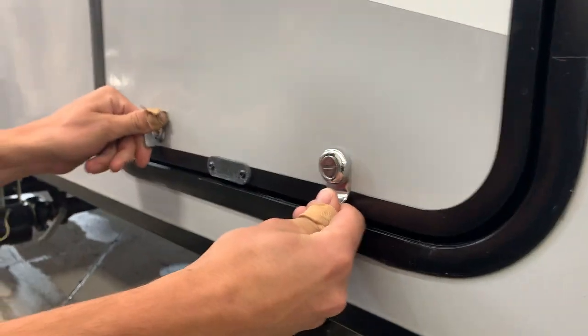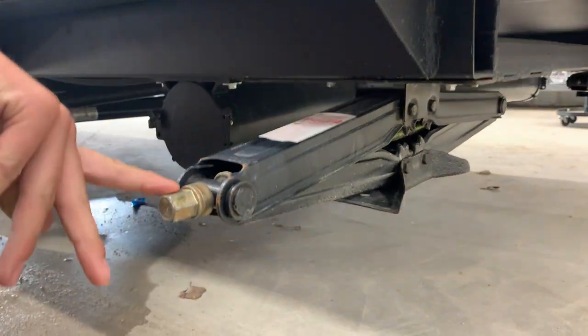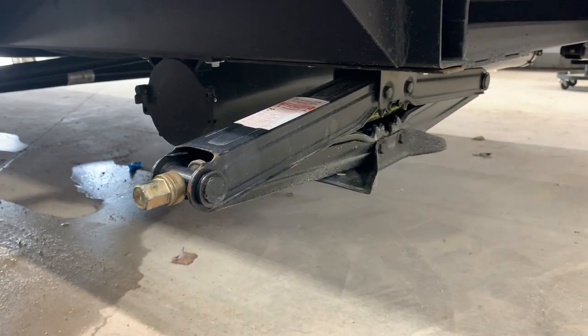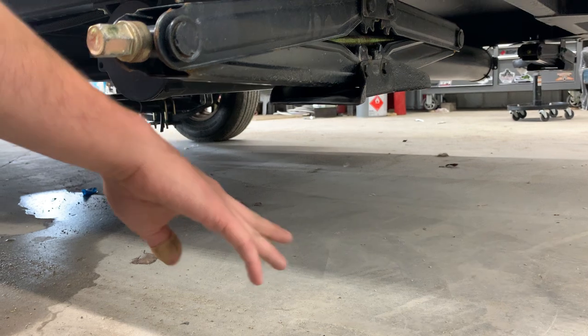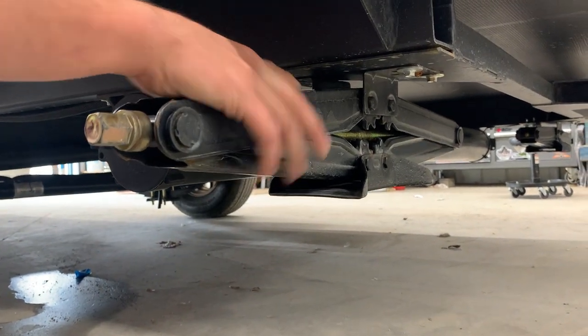You do have a little bit of storage space in this corner as well as all four corners of the unit. You do have stabilizer jacks — the way those work is you just take the tool, which is located inside the front compartment — it's just a three-quarter inch socket. You take this foot, run it down to the ground. Once the foot contacts the ground, just give it another eighth to quarter turn to snug it up, and it's going to take any bounce or sway out of the unit.